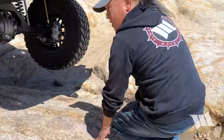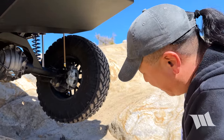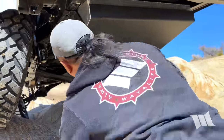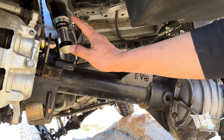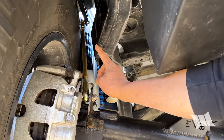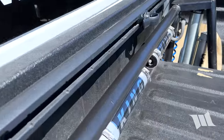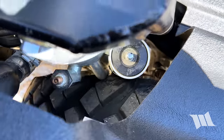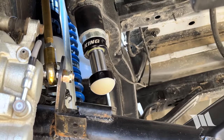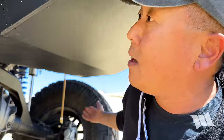Let's give a look underneath. This is totally full droop — we're totally crossed up. The rear passenger tire is maybe about eight to ten inches off the ground. And I can already see a problem: our rear axle isn't completely centered, and because of it — unlike the passenger side — the sway bar link is rubbing into the side of the tire, and the tubes on our bypass shock are rubbing the sidewall as well. This is at full articulation, even though the air bumps aren't making contact with the axle. I don't think they're going to while articulating, because of the torsion bar. The other side looks good.